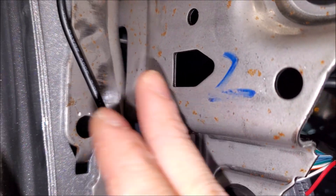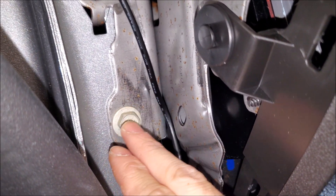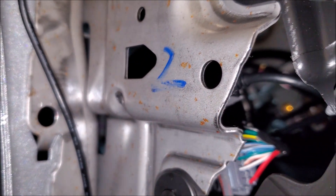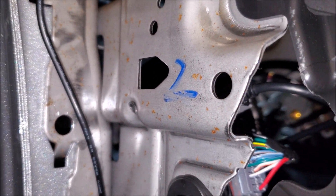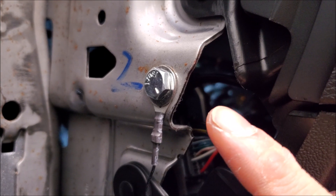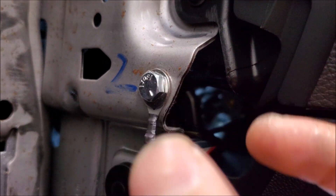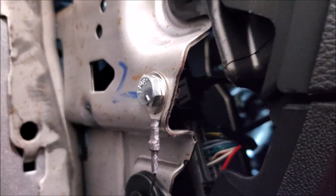Another area where I'll go is actually the subframe here, because these bolts go right into the chassis and this is bare metal. I find for low current devices, this works perfectly fine — just use a nut and bolt. This is what a simple nut and bolt solution will look like. You always want to make sure it's really tight. I prefer this over self-tappers, because you have a lot of clamping force when you use hardware like this.